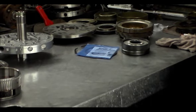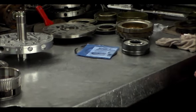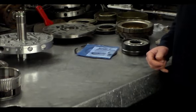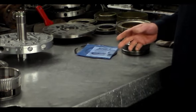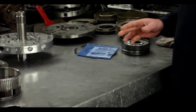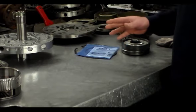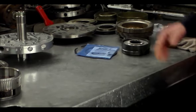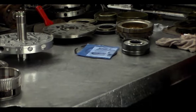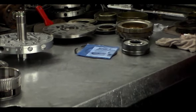That's about it for this 2004 Ford F-350 Super Duty with the 5R-110W. Again, this came in with no reverse. Anytime you have no reverse on these earlier ones, you want to check that case and see if those lugs are broken — usually it's due to runaway line pressure. For these earlier ones, I highly recommend the Transgo shift kit — it's a really great product, and they have great support if you need to call them. I talk to those guys a lot and they're very helpful and very knowledgeable. Thank you guys for watching, have a great day, and we'll see you on the next one.